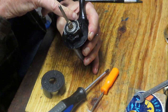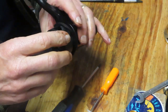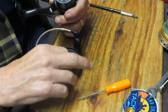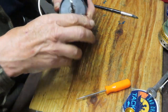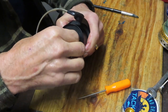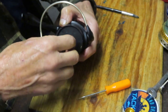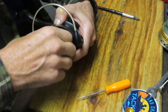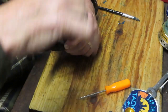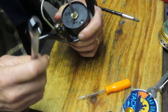Find the opening on that plate — there's also a stud that's going to sit inside a piece here, just aim it. That's our cover. Now we can take our rotor, set it back on there, grab that rotor nut. Remember this was a reverse thread, so it's going to come back on turning towards you. I like to do this by hand because I don't want to risk cross-threading it. Let's give this a tightening down here. That should be good. Then we have one more screw under here before we go to the exterior screws.